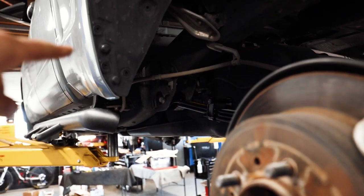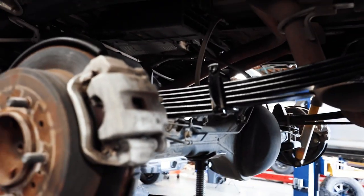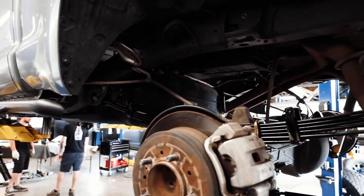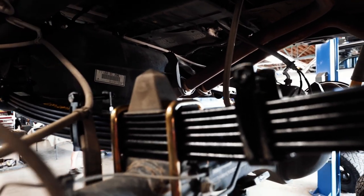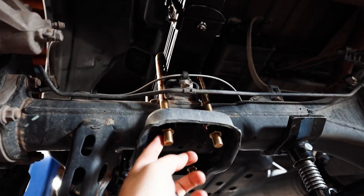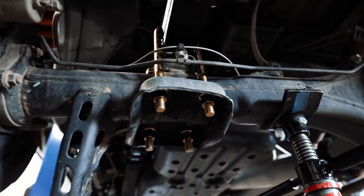Dylan put in the front bolt of the leaf pack — again, don't tighten and torque that down, same with the rear, until it's actually on the ground. You can torque down the U-bolts when we get to that part though. Do not torque that front leaf bolt or the rear hanger bolts until the truck is on its own weight. Go ahead and put your bump stop back in — I recommend upgrading your bump stop if you're lifting your truck. Use the Dobinson provided U-bolts and hardware; put one on a corner and one on the opposite corner, make them as even as possible, then torque them all down.